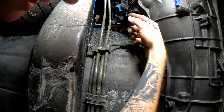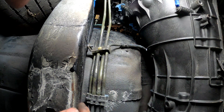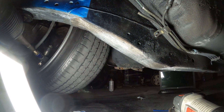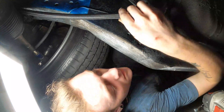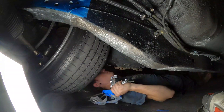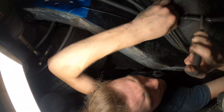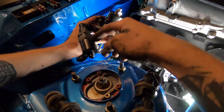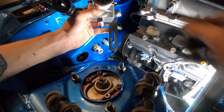There's no way you're going to get the Chase Bays lines over the flanges, so I'm going to get the angle grinder and cut each of these. Your fuel feed comes into here, your fuel return comes out of here, and this is the short hose that runs to the back of your fuel rail on your VQ.